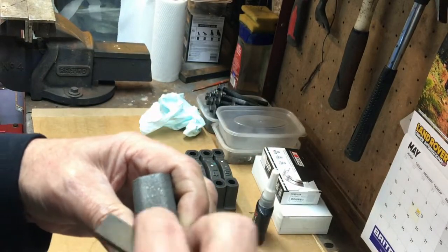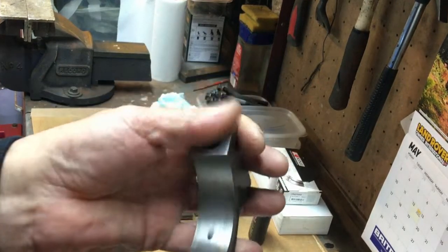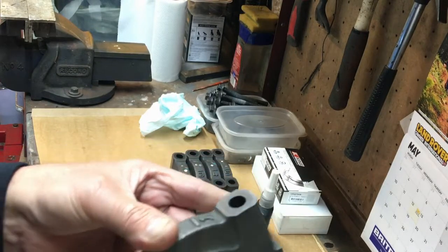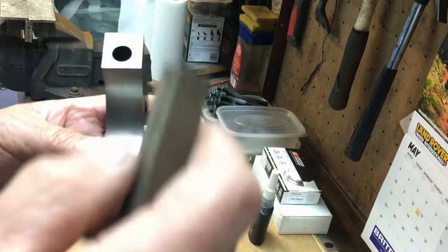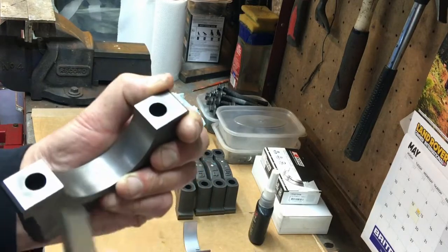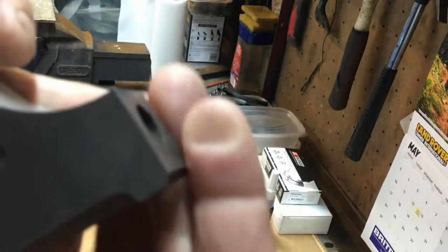You could stone these side faces too — just give them a gentle stone. All you want to do is make the face perfectly flat. Once you've done that, these parts need to be cleaned again: blow some brake cleaner on them and blow off with compressed air, or wash in clean paraffin. Don't put them in the engine without cleaning because any deposits will turn your engine oil into grinding paste.